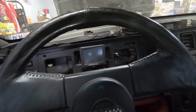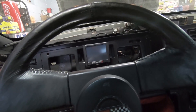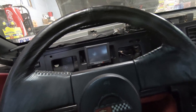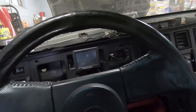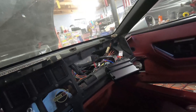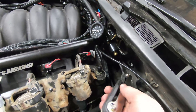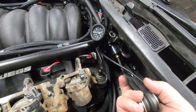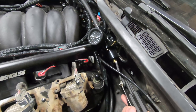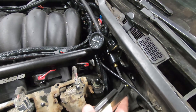If you do pick a power adder like turbo or supercharger, it'll ask you a couple more questions like ignition timing changes after zero PSI - all kinds of fun stuff to keep you from blowing up. We don't have to worry about that since this is a stock Corvette. Now that the wizard has cycled through, the ECU should cycle the fuel pump so we can set the fuel pressure. I'm going to start by turning the regulator down pretty far just in case it's set at some crazy high PSI - we won't blow our rubber fuel lines.